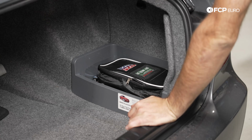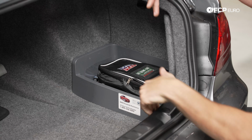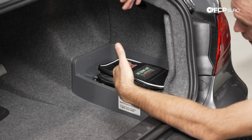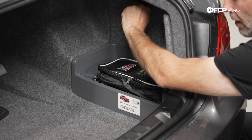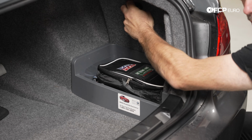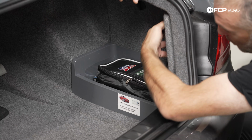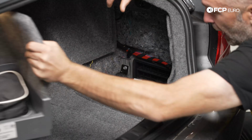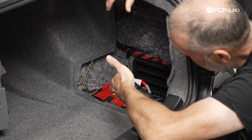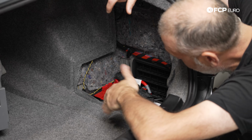Like I said earlier, a lot of BMW batteries are in the trunks on the car, on all these cars. Usually going to be on the right-hand side. Some cars will have it in the middle. In the case of the M3 or any of your E90s and your E8X 1 series cars, they'll be behind this little compartment cover here. So you have a knob that we just kind of turn to the side, and then that gives us access to our battery right here.